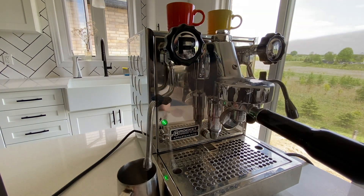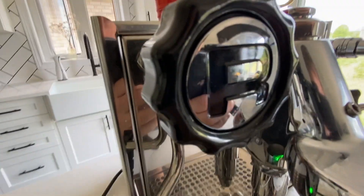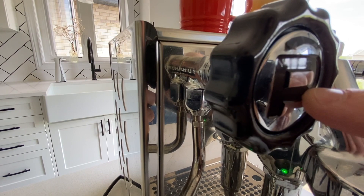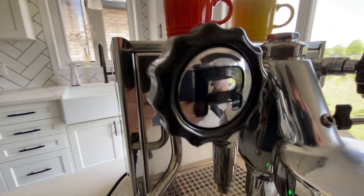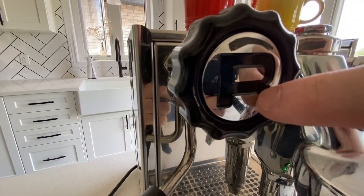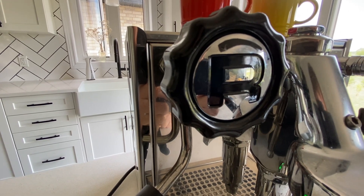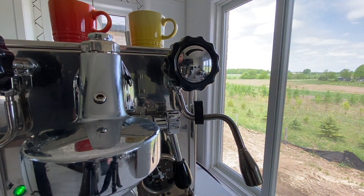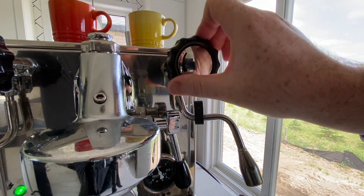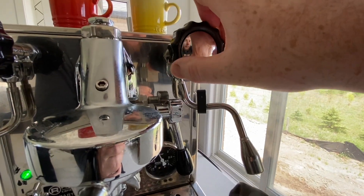The steam pressure is also fantastic, and though it took a little bit of getting used to coming from a Gaggia Classic, I really really like it now. Recently I noticed that the knobs themselves are not all painted and the little gauge graphic is actually a sticker, which has disappointingly started to peel off. Not a huge deal, but it's just a little bit disappointing. The knob for the hot water wand is the same. One thing I've noticed is that the water seems to be a little bit hot, especially if you're making drinks like Americanos — you can see how much steam is coming out when what I really want is just hot water.